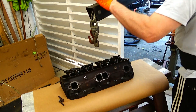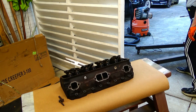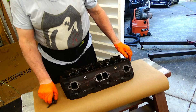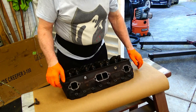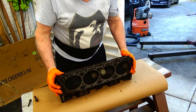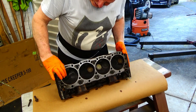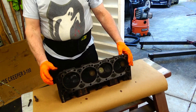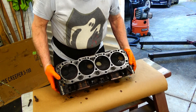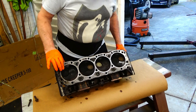It's good to know what the issue was, because now that I have it out, I know exactly where to look - looking for this exhaust valve right here. This thing's heavy, I would not want to have to lift that. I can see the valve is open and it shouldn't be - it's well open. That's an easy one to see: the exhaust valve is stuck.